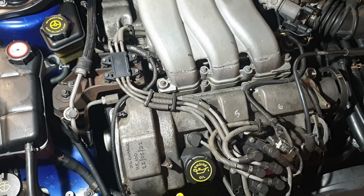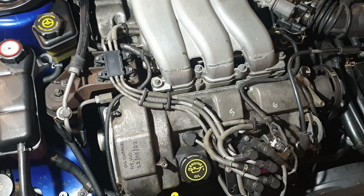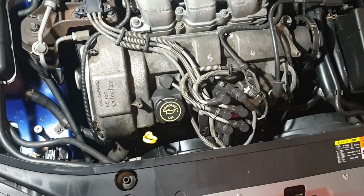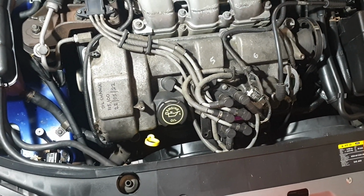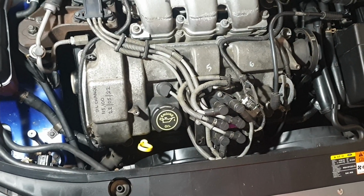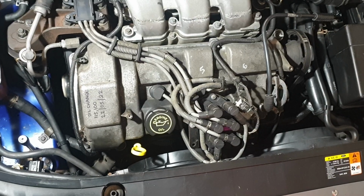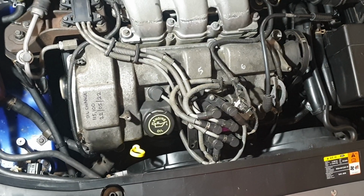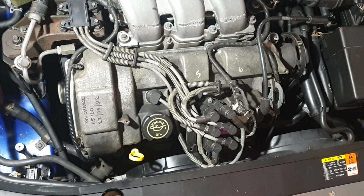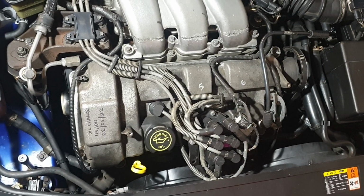Once I finished doing the rear end restoration, I started on the front. I took the sump off, took the oil pickup off, and I found little metal shavings in the metal gauze in the oil pickup. So that rang alarm bells with me, and it went off up to Tamworth, Carl Stacey, Dean Gaskell, Auto Infinity, they replaced the bottom end shells for me. A bit of preventative maintenance, I hope. So yeah, that's the two main things to look out for.